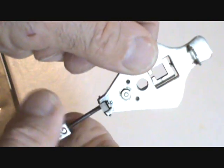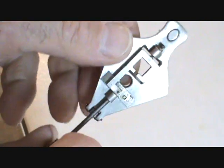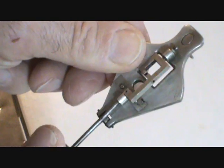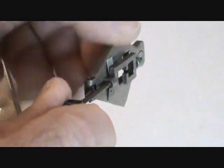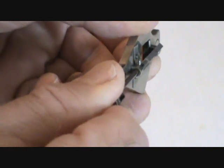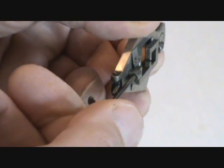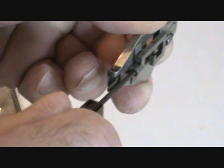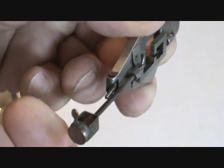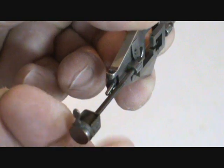Here we see a few other components of what a Model O reproducer contains, which are also similar to the Model M reproducer of the opera. We see the little hole where the pin would go, fitting through the body of the stylus bar and coming out the other end just to hold it in place. Here is another piece of a Model O reproducer — the upper part facing the diaphragm and the lower part facing the record. Here's how the turnover mechanism works: there is a spring underneath which is bowed out, and when the stylus bar turnover bar is turned it flattens that piece of spring. When it comes back up the spring bows back and holds the stylus bar in place, preventing it from flapping. The stylus bar turnover device can only be turned in one direction — you either turn it one way for the two-minute stylus or the other way for the four-minute stylus; it doesn't turn in a complete circle.